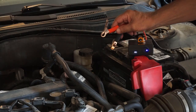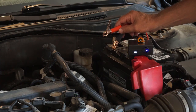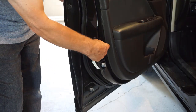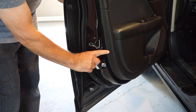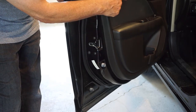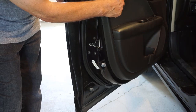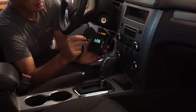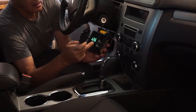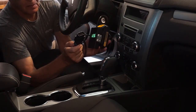Before hooking it up to the battery, we're going to take a couple of preventative steps so that the modules do not get reawakened during this process. First, we're going to cheat the door latch and wait for the courtesy lights to come off. This will give us access to the passenger compartment if we need to get to the fuse panel or the DLC. We're going to be disconnecting the negative terminal of the battery, so I'm going to put this memory saver in. You'll recognize this as gadget number 14, a DeWalt-powered memory saver.